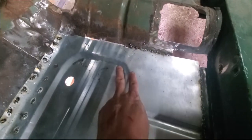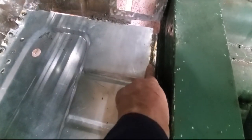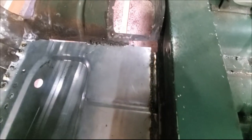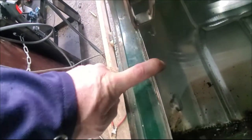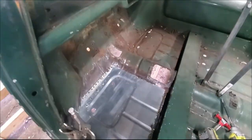I got that little sliver there to do. I'm gonna add an extra piece in here and weld that in. I'm gonna do this little section here — all this has been back-welded and double-welded because I found a lot of hot holes in it. I don't know if I'm actually going to grind these down — I think I'm gonna do it from the underside. This is gonna be all covered with carpet, so I might go ahead and grind this down just for aesthetics so the carpet meets correctly. It's about 100 degrees in this garage.